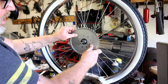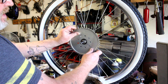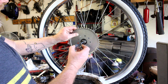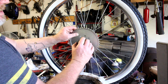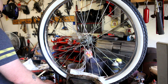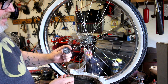There's a flange on the hub that pretty much mates even with the inside of the sprocket. If you run without the dust cap that's a possibility, but I prefer to keep some of the protection the dust cap offers. All we have to do is grind just a little bit off of either the sprocket or the dust cap — I prefer the dust cap.